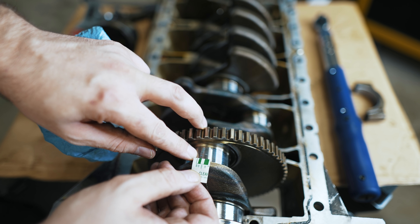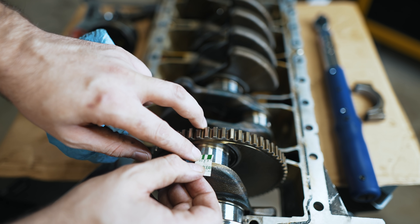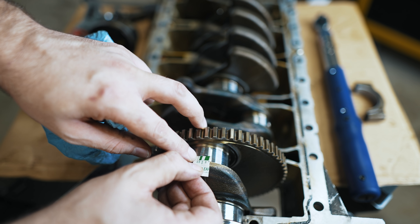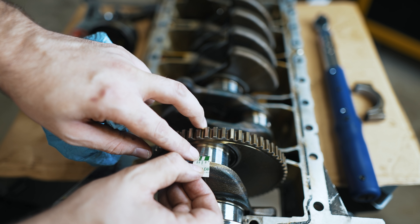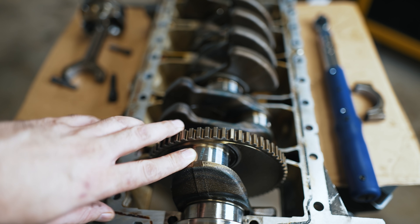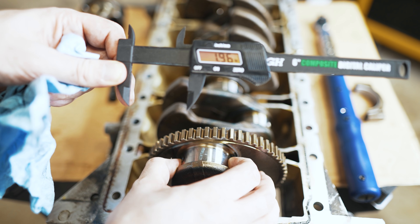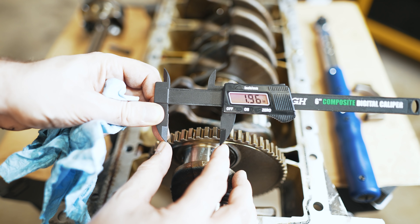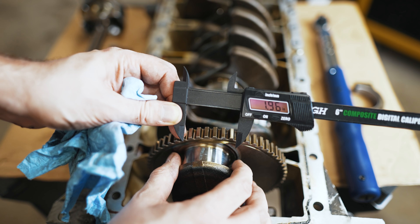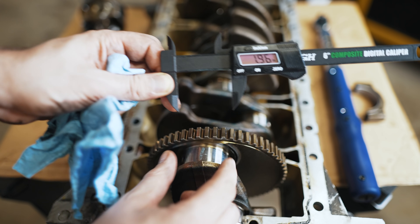Just like last time, and I know now that that's no good. You actually want to be somewhere in between the green line and the white line. It should have been ideally about 60% as wide as this plastic gauge. High horsepower motors would actually call for bigger clearances — for every inch of journal diameter, you want at least a thou of clearance for a regular motor, and probably half a thou more for a performance motor. So I'm expecting with the stock bearings, this is going to come in a lot thinner and my clearances would have been larger.